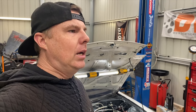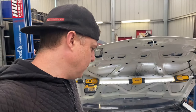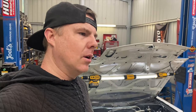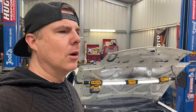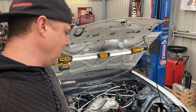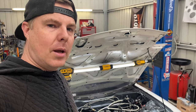With baffles and two breathers, fingers crossed that covers everything. Realistically, if I still have a fuel pressure problem, it's definitely the pump. The company's website is gone now, so no parts available. I'm pretty sure it's like a knockoff Waterman pump — someone told me that once. I bought it many years ago when I was building the 626, future-proofing parts, and got it bundled with a pair of MSD DIS ignition boxes for well under a thousand bucks. Now I'm going to pull it out, sand it back, and give it a lick of paint so we can hopefully go racing.